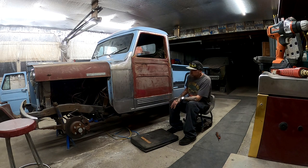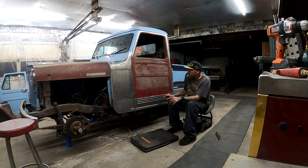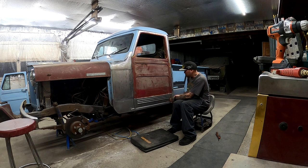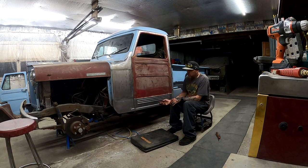Tomorrow I'm going to take the door back off and cut about an eighth of an inch off the bottom of the new skin I put on — the inside piece of the door — just so I can scoop the skin up a little bit higher if I need to. Once I get this hammered and pinched flat, it may change a little bit.